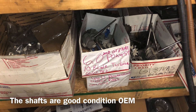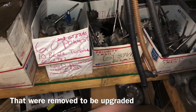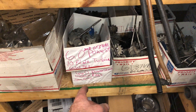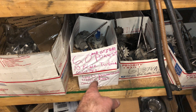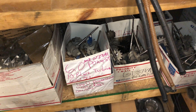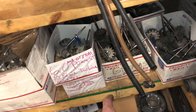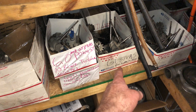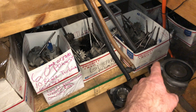Below in the description box I'll link to all the parts you may need to do your rebuild. I have a bunch of shafts in good used condition, but mostly I sell the new 2003 turbines. If you use that in an 04 to 07, the turbine housing will have to be machined for the blade height. Some people have asked me about stock replacement of the GT37 VAS 66 and 64 turbines.